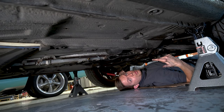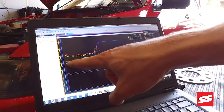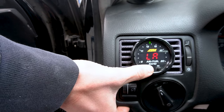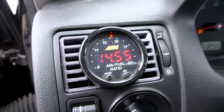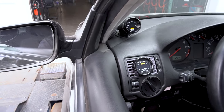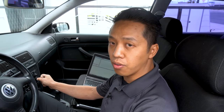All right, we're all installed — let's get Sam and get this thing on the dyno. Sam with AEM Electronics here. Today we're on the dyno with our test vehicle doing testing on the X-Series wideband to show how fast the response time is compared to the classic series wideband. On this vehicle we have both the X-Series wideband and the classic digital wideband. We'll do a run on the dyno — halfway through, a rolling anti-lag switch will force a misfire which should show up as a lean spike, then we'll look at the data and compare response time between the two gauges.